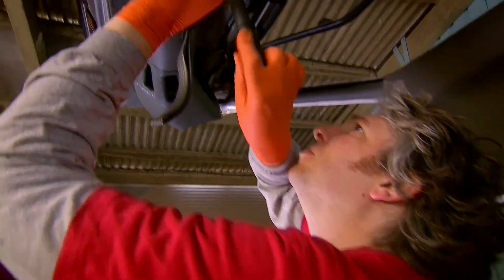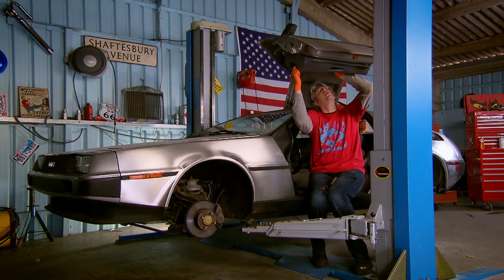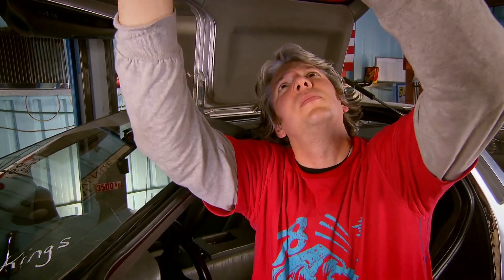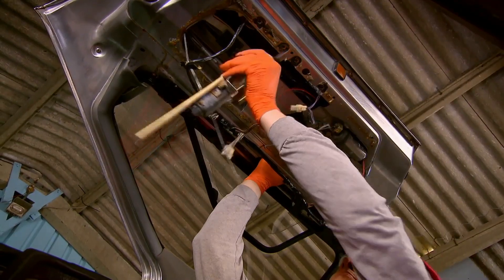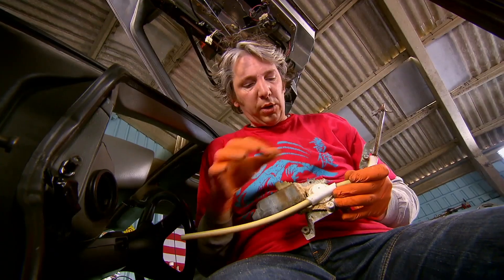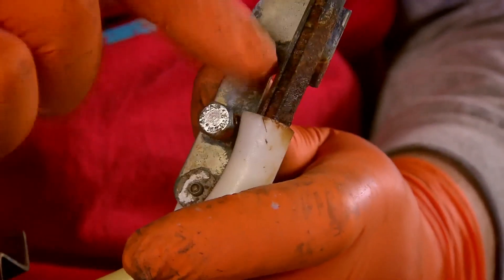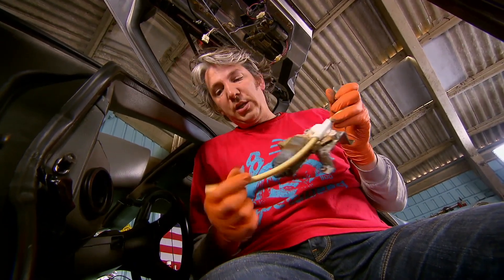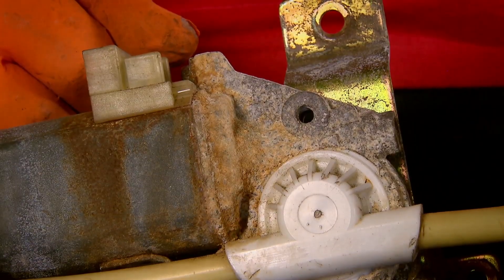Gullwing doors are a huge attraction of this car and working on them is challenging for two reasons: one, you need to constantly pull them low enough to work on, and the other is razor sharp panel edges inside the door. Here is our window winder mechanism — there's a motor, that's where the wires go, and there's a little gearbox that goes on to this kind of spirally spring type device. You can see straight away there's loads of corrosion — water's been getting in through the seals of the window. This little drain clearly hasn't been doing its job either, so the whole thing is seized solid and unfortunately it's going to have to go.